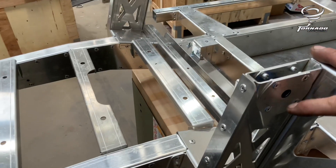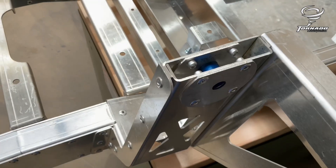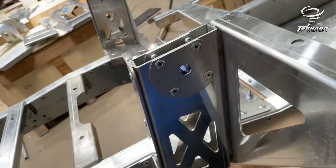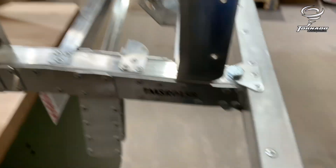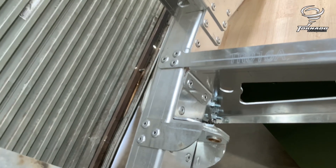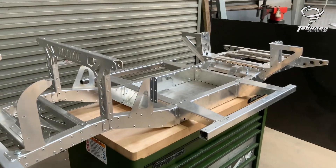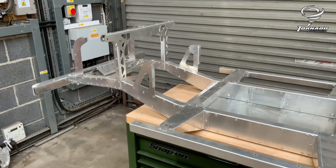Putting this bush in here — you've got the inner plate and the outer plate. Put the inner plate on, push that bush in; it's a little bit tight so just rub it down slightly to get it in, then put the outer one which holds it in place. Same with the front bumper — there are crush tubes in there; they aren't mega tight so they can fall out, but you can push them back in afterwards. At the bottom of the panhard rod here, I bolt those two in because it's very hard to get a riveter in there. If you do make a mistake, it's not hard to drill the rivets out — just try and get it as good as you can first. It comes with those drawings I showed you earlier, so you should be able to get the main rails pretty well right. That's it for the chassis.